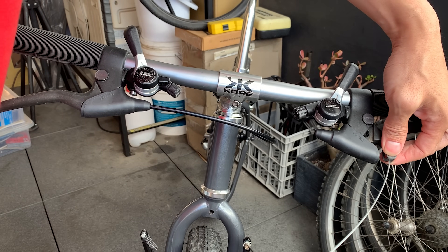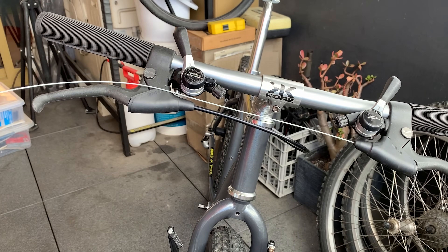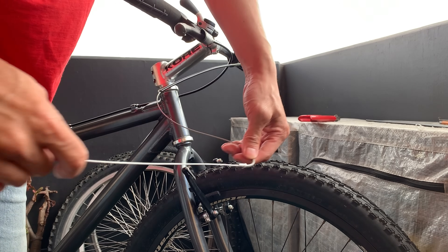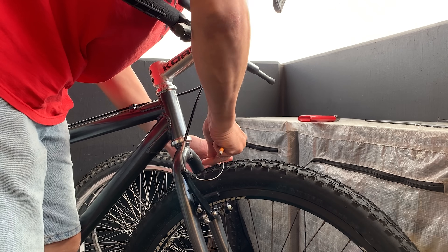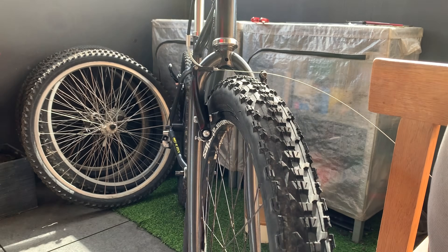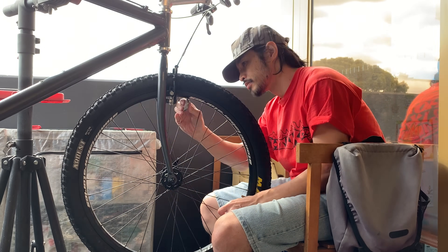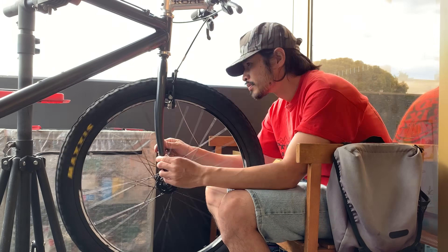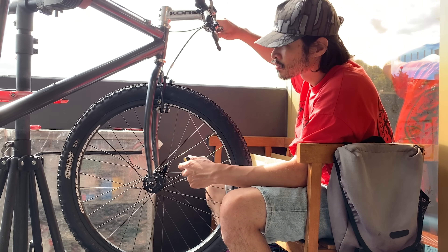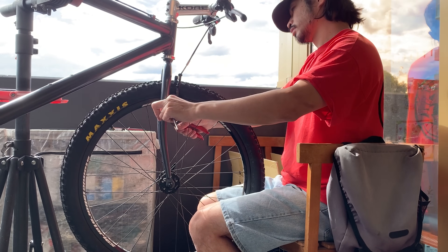Don't forget to clean up your cable ends after cutting — you can put a spoke through or re-cut it if it's not a clean cut. Mountain bike brake cables and road brake cables are a little different: mountain bike and BMX ones have a little puck shape at the end, road ones are more like a mushroom — so make sure you get the right ones. When lacing up the brakes, I usually eyeball the cable length. I realized my wheel was out of true, which was causing the brakes to scrape — so make sure your wheel is true before adjusting your brakes, otherwise you'll have to do it twice. True the wheel first, then do your brakes.